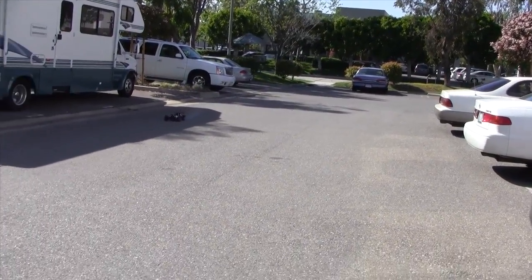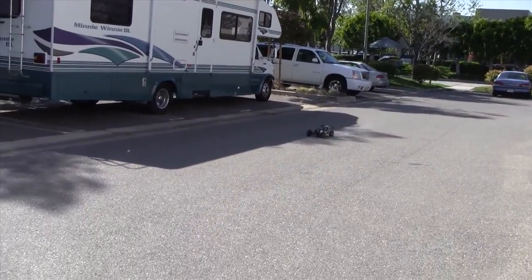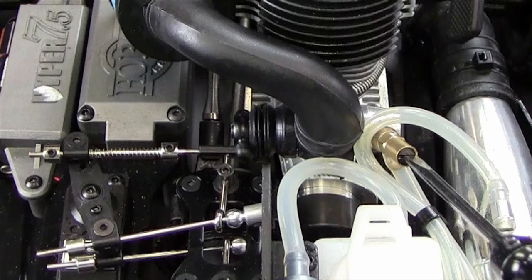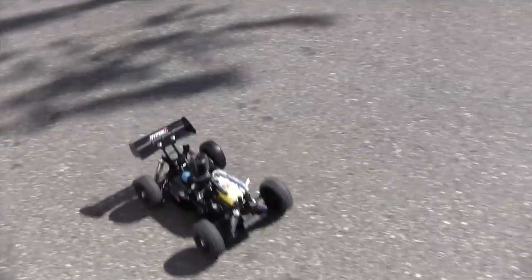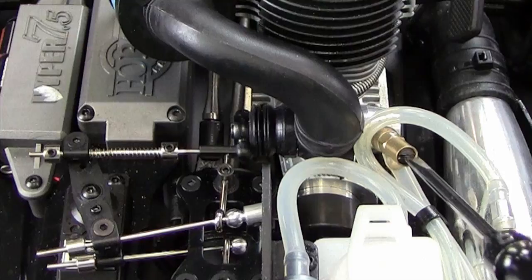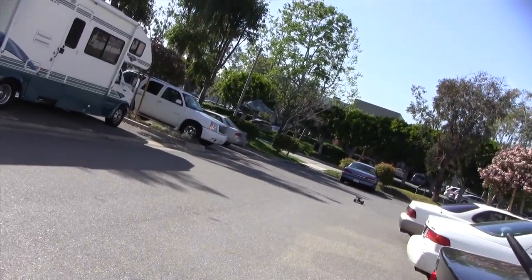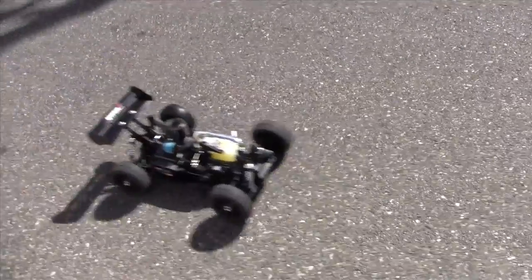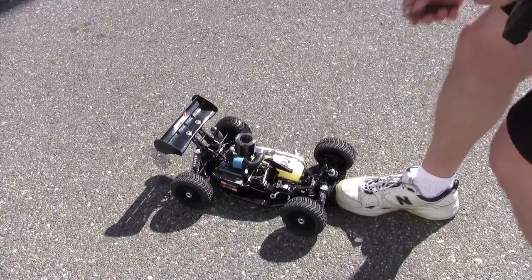When adjusting the mixture of the carburetor, always adjust the main needle first, as this affects everything on the carburetor. This is an example of a motor running rich — the motor will splutter and cough with a lot of smoke coming out of the pipe. When the engine is running rich at full throttle, turn the main needle clockwise to lean it out. You only need to turn the main needle one-sixteenth to one-eighth of a turn. Start rich on the main needle, then make full-throttle passes leaning it out a little at a time, stopping when the motor sounds crisp and still has smoke coming out the pipe. Note the sound and lack of smoke when the motor is leaned too far.